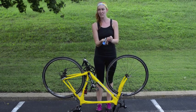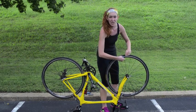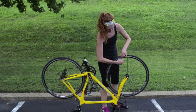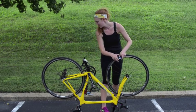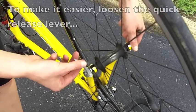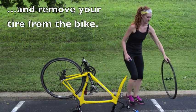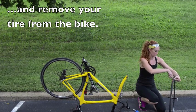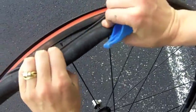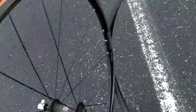These are cool because they're built into my multi-tool. What you'll do is wedge one underneath the side of the tire so that the wheel comes out of the rim. Try to pry the rubber out. It's really helpful to have two here. Be forceful because the rubber is very stiff and it's not easy to stretch over the rim — it takes some muscle. Once you get the edge over, it will be much easier to remove the rest.